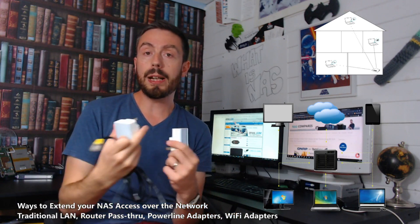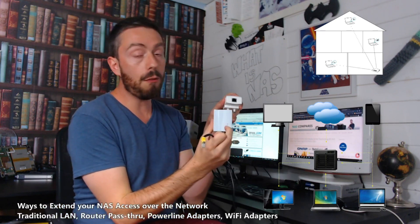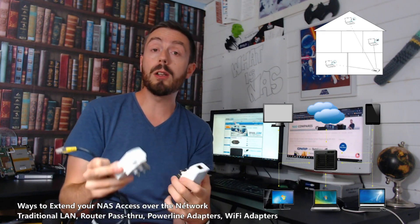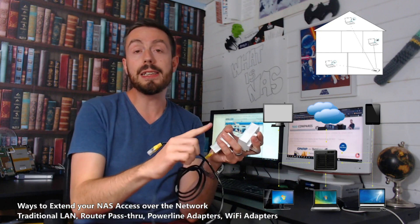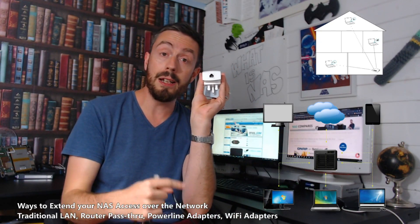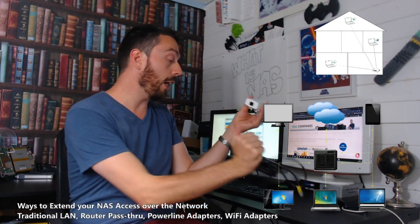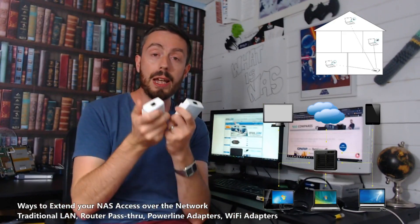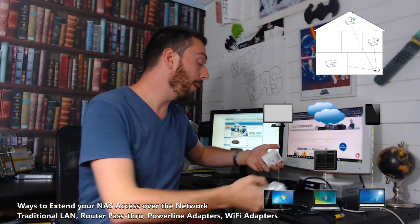This gives you the ability to store the NAS anywhere there is a plug point. There's no real limitation with power line adapters — you shouldn't use more than about eight as they can get a little confused — and they pair up with a button. The ones you go for will affect the price: you can get some at 300 megabits per second, all the way up to 2,000 megabits theoretical per second. Some have just one port, but others come with three or four ports built in, working in parallel back to the switch via the mains current. You can also get Wi-Fi versions, which are the best solution for coverage and accessing your NAS over bigger distances.